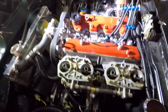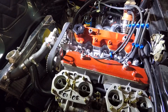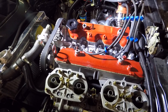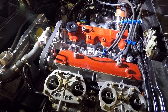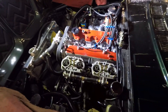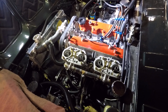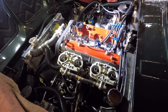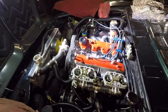It also features our 285V street cams, which are a great cam choice for a 2-liter because it makes all the power through the mid-range up to about 6,200 RPM, which is the operating range on a street-built 2-liter engine. So with all the lightweight parts on this car, the engine revs really freely. This engine will put out between 135 and 140 horsepower. It hasn't been dynoed yet because we're still in the break-in phase with this motor.